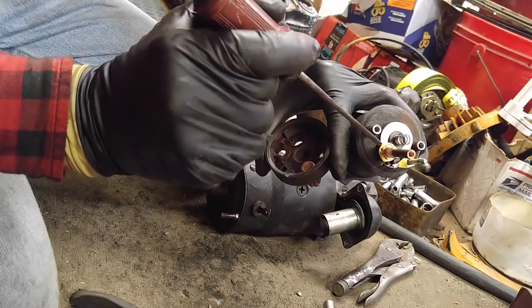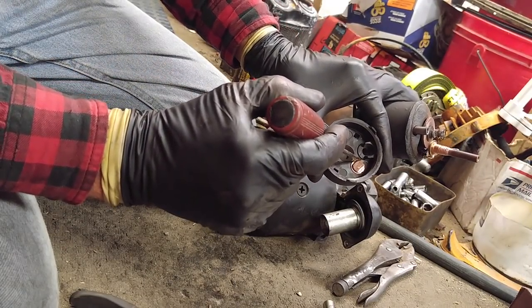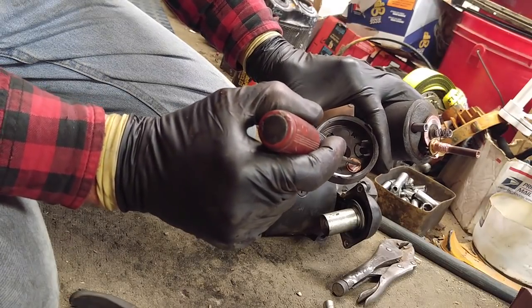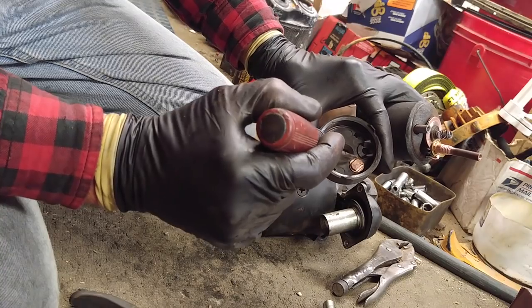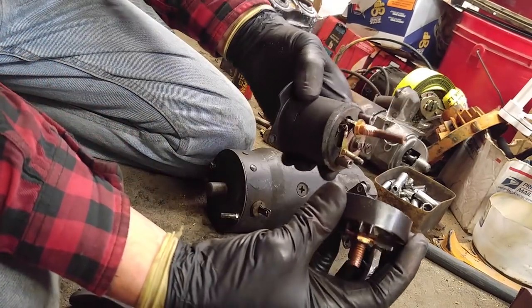this disc contacts power from the battery, and it contacts right there on not a very large area, right there. See where it's worn away here? So I flipped the bolt around, but the diesel has a bigger bolt. I took apart a few solenoids and I found an original.